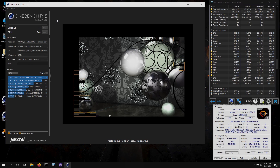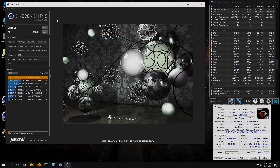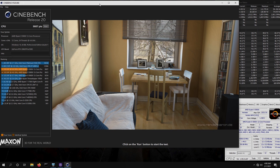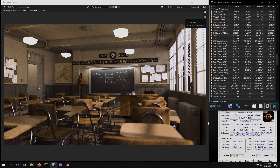With an all-core boost, we're sitting at 4.6GHz. In Cinebench R15, we're up 319 points to 3885. Next on R20, there's a 669 point gain as we get over 9000 with a score of 9007. The Blender BMW run shaves off almost 8 seconds, coming in at 1 minute 50.92 seconds. Finally, Blender Classroom is 21 seconds faster at 4 minutes 41.72 seconds — the first sub-5 minute time I've seen. Very impressive.